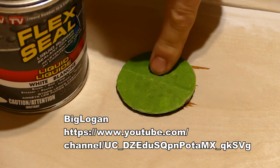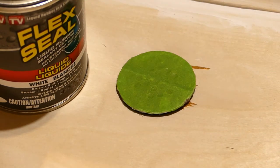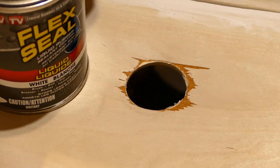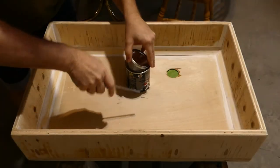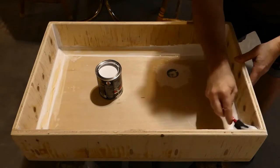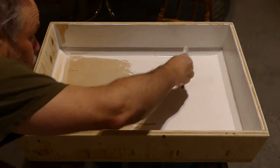The idea was to tape up the drain so we could build up the Flex Seal around it and smooth it to provide water an unobstructed path. However, it's minus 25 Celsius here — minus 13 Fahrenheit — so I'm currently working in our basement rather than the van. I'll apply the Flex Seal with the drain removed, and when warmer weather arrives I'll add a final coat of self-leveling Flex Seal to fill the tiny ridge around the drain. Applying the Flex Seal wasn't overly cumbersome. I ended up using a throw-away foam brush and wore one brush out two-thirds of the way through the first coat, so it might be a good idea to have a spare brush on hand.